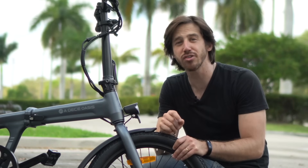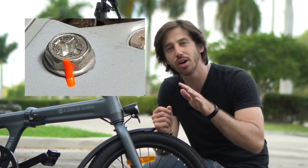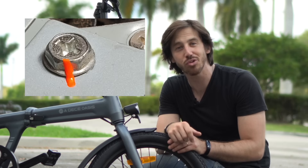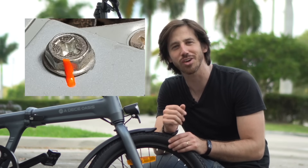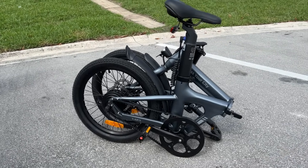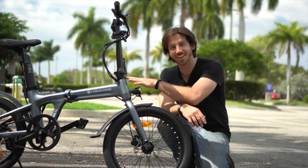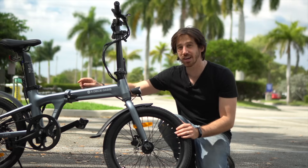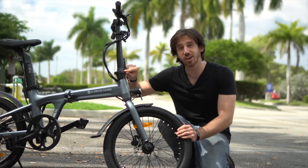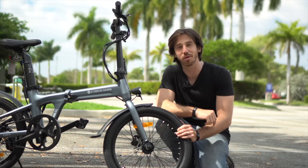If you're really worried about it, you can make it easy by taking a paint pen and putting a line across the bolt onto the bike — that way you can just look at it and see if the line lines up to know the bolt hasn't moved. If you have a folding bike like this one, the 80 Air, you're going to want to check the bolts and the folding mechanisms as well, because it's critically important that those stay tight. Either these folding mechanisms in the middle of the bike or at the handlebars — if they were to come loose that could be very dangerous, so check those when you go around inspecting your important bolts.